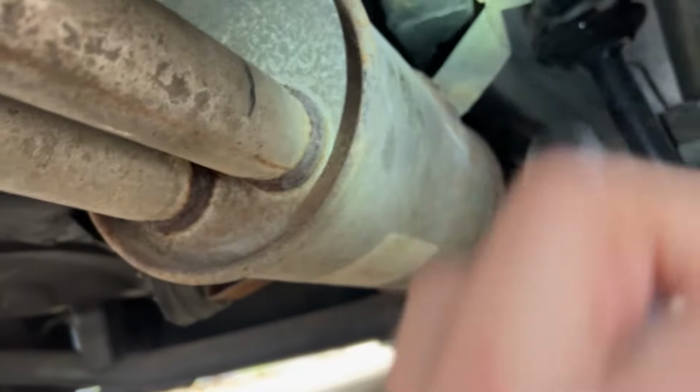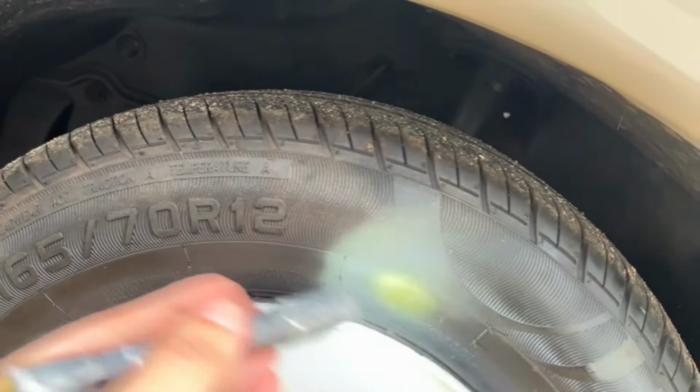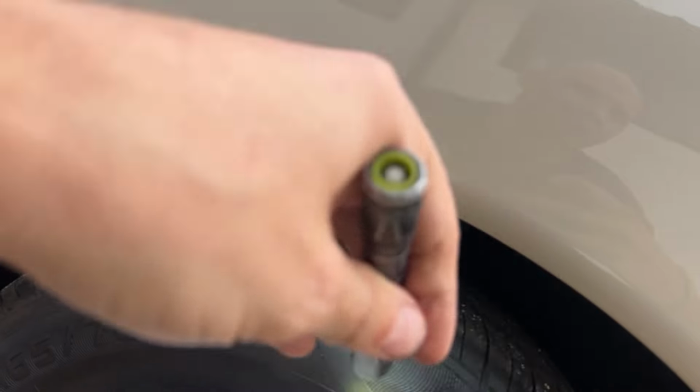Here would need welding. I took some pictures as much as I can. This shock absorber section, as you can see, there's a hole and fiberglass compound just to hide it, and this collar is heavily corroded. In the arch sections, surface corrosion is developing, not to the extent where it affects integrity. These are plastic wings. Both springs are corroded. They're not the same. So this one, it looks like it's broken, but it's not broken. They fitted the springs on the new shocks.